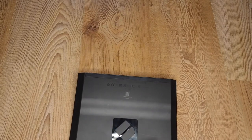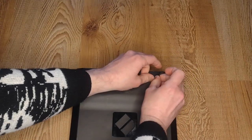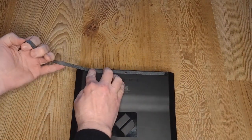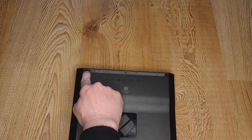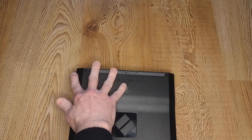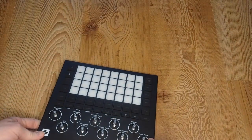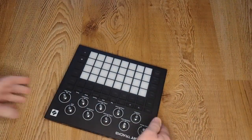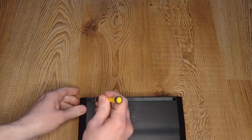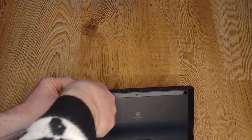Those two are pretty straightforward, and here's where we start to get into Novation's deviousness. When you pull the top rubber strip, it looks like there aren't any screws — it looks like there's some kind of case fitting, but it's not. These are just two plastic cylinder stoppers they've put in there, so be careful. I'm bracing them with my fingers — they're going to fall right out. Underneath them, that's where the screws live, and they're painted black to blend in with the plastic of the case. A little devious.